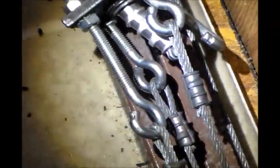I don't have the tools to fix the cable, but luckily it was a really easy repair. If you're having a problem with your pop-up camper not closing properly or raising, check your cables — more than likely that's going to be your problem. This one just popped off the eye bolt, the tensioner. This is actually a universal tensioner that tensions all four of your corners.